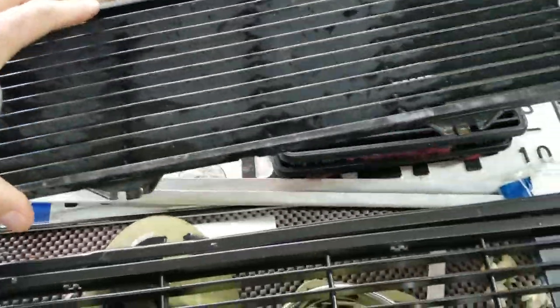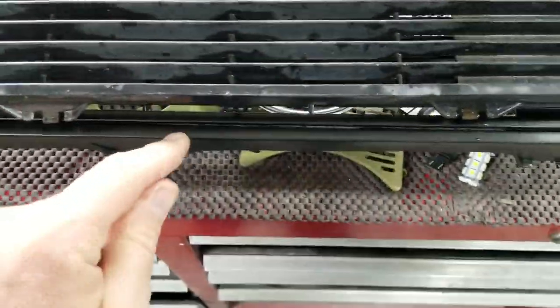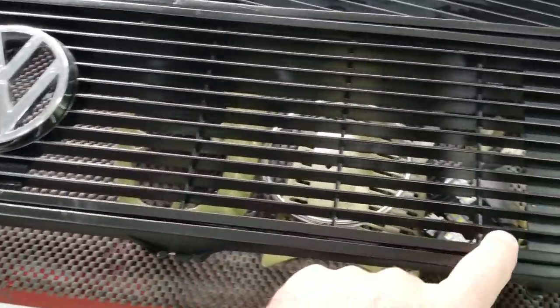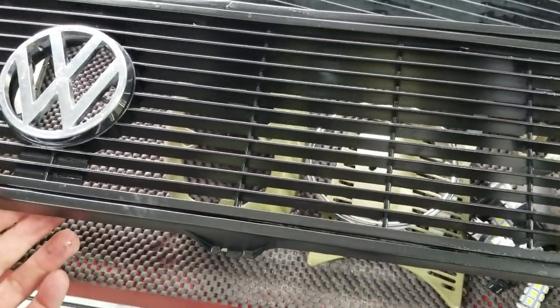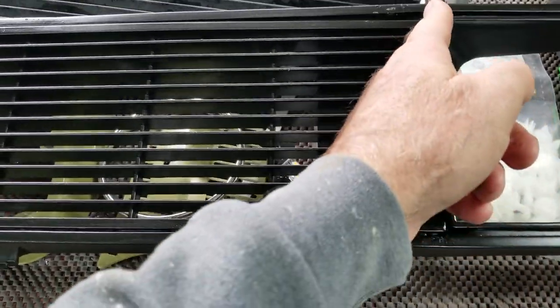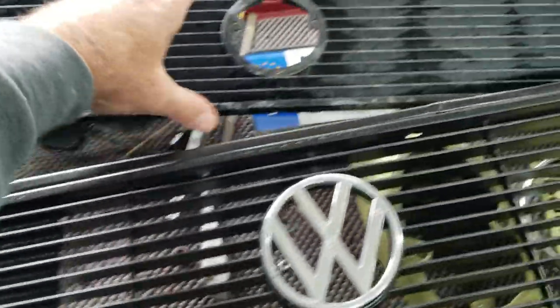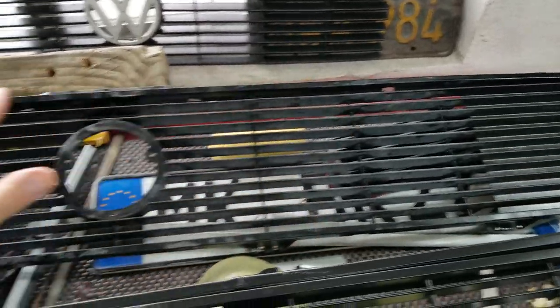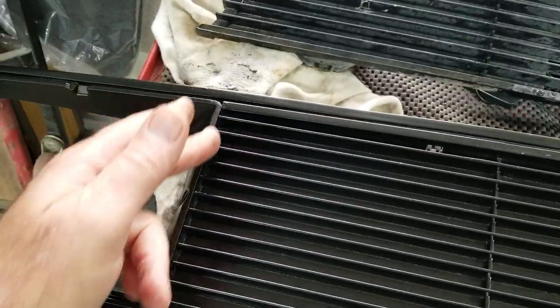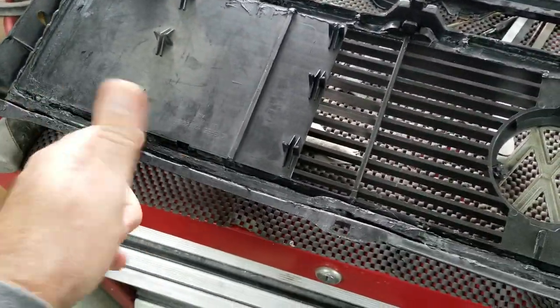This part right here actually fits inside the other grill. The old grill is right around here, and the round-eye grill fits right inside of it. If you cut very carefully along here with a good cut-off wheel — cut out here, cut around here all the way around — you can graft this part of the round-eye grill, which are available all over the place and can be bought new. Cut it straight so that it matches here and here, then inset it from the other side.